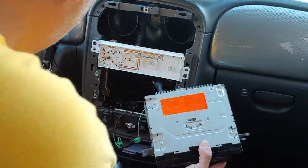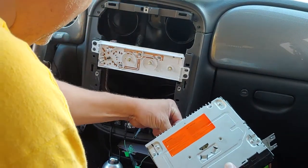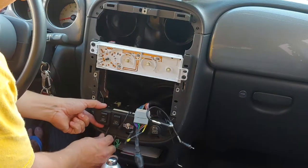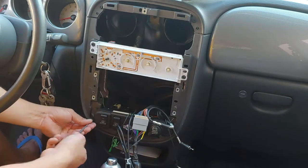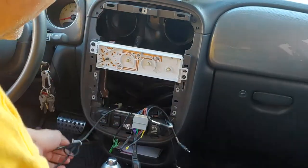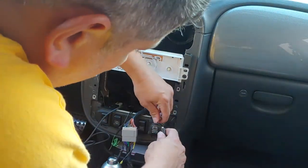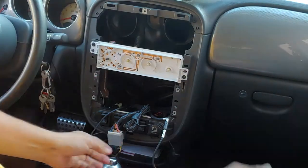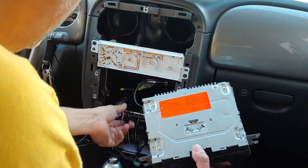I'm going to use my cable, which I accidentally locked in there. Don't make this mistake — I'm going to need to come right back to it because I accidentally locked it behind the unit. Make sure you don't pinch any wires either, because that's important. Make sure you don't have anything that's going to mess the connection up over the installation. At one point I had pulled this apart thinking it was going to come apart, but you actually need an adapter for that. So there's the antenna. Even though I don't use radio, I'm still going to attach the antenna — I haven't listened to radio in a long time, but I'll leave it on. My car doesn't even have an antenna — I took it off when I was using an FM transmitter because FM stations kept interfering with the broadcasting.